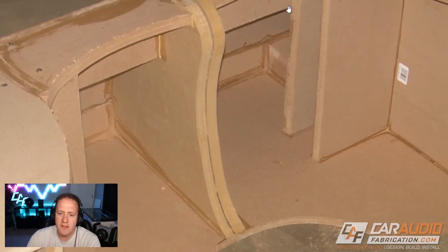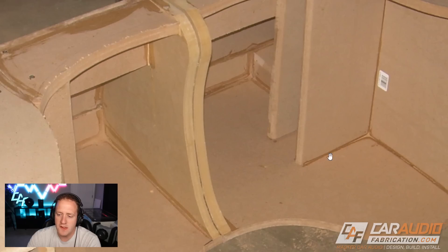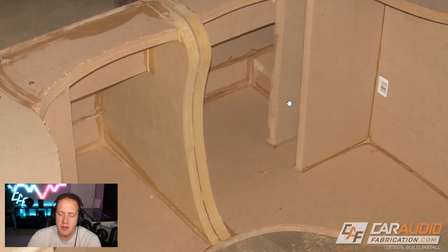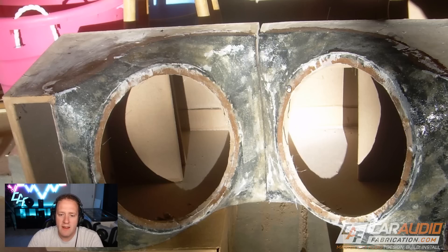What I will say I did a pretty good job on — even though this was a really complex shaped enclosure — I did keep everything pretty square. It looks like all the surfaces mate up to each other nicely, with a nice wood glue seam between each of them. It is interesting that with these two different halves set on a flat floor there is kind of a gap between the two. Today if I was forced into doing two separate halves like this, I'd definitely want a plan for hiding that seam and have a plan for how everything is going to be held perfectly flush together while keeping the bottoms at a 90-degree angle to that plane.